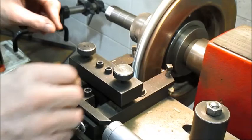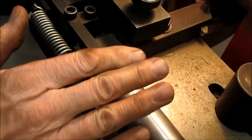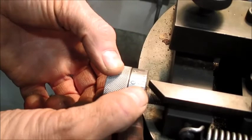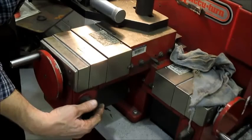Now how deep to go. Here's a little numbered collar. I'm not turning the cutter yet — I'm just going to set this to zero. I'll take off about eight thousandths. Between five and twelve thousandths is usually a common depth of cut. I'll do the same on the other side: zero the collar, then dial in eight thousandths. Now with my vibration dampener on, cutter bits tight, and cutter holder locks tight, I'm going to engage the self-feed, which leaves the best cut and lets the lead screw automatically feed.